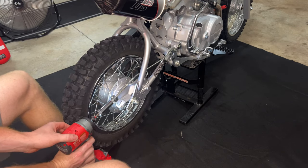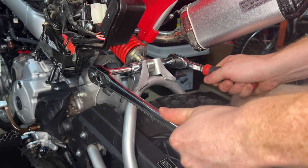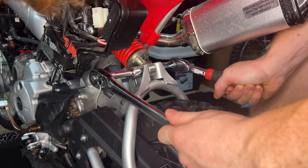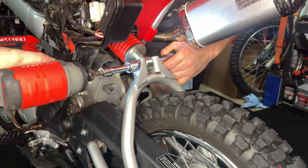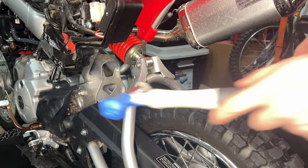Now you can adjust the brake rod so we can move the swing arm. Loosen that up and we can get to the bolts — it's a 17mm lock nut with a 14mm head. The two bolts on the shock are identical, so don't worry about mixing them up.